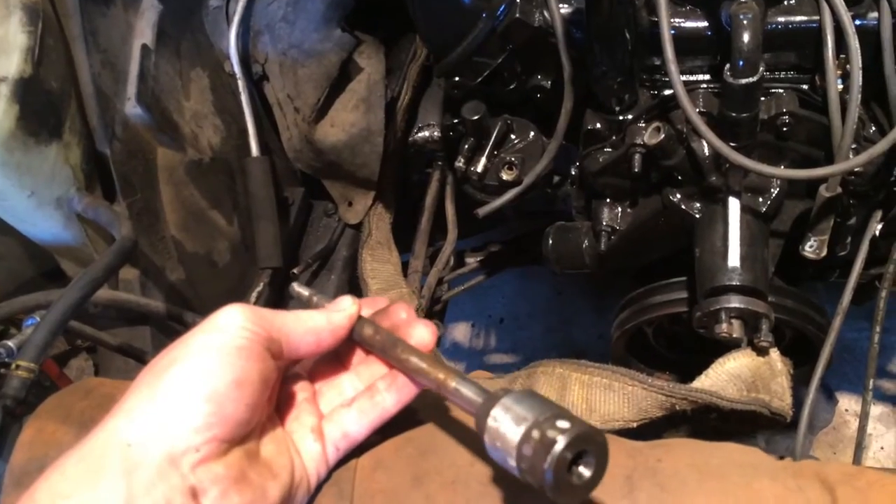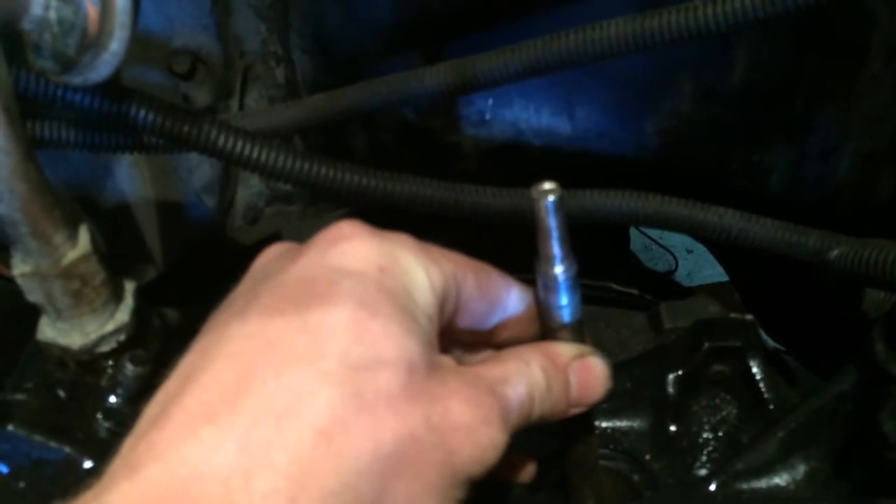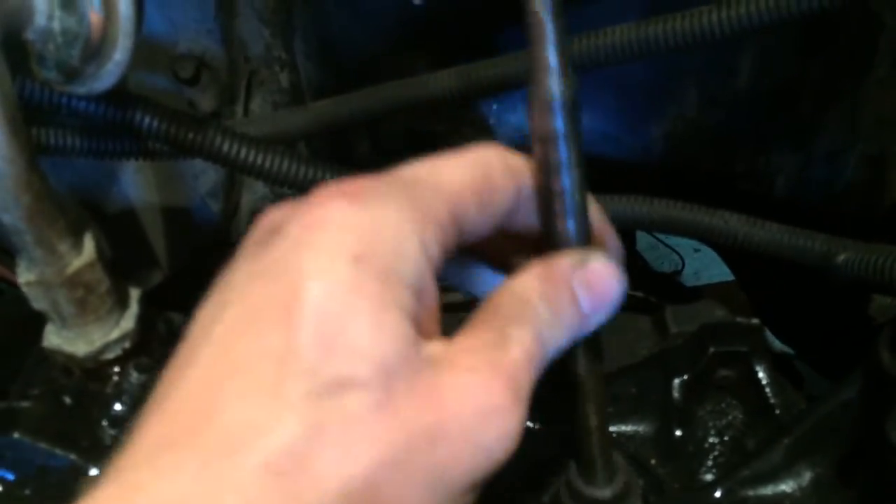You want to save that oil pump tool you used. Stick it down in there until it's on the oil pump and turn it a little bit — it will take a couple tries. Then try, whenever you're putting the distributor in, to clock the rotor to where you want it and see how it lines up. If it doesn't line up, just keep turning it until it drops in. Then you'll know how far you have to move your oil pump.